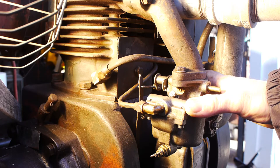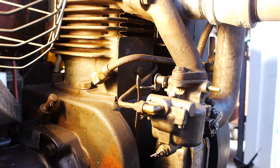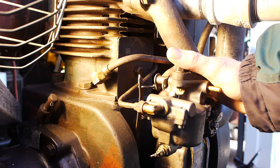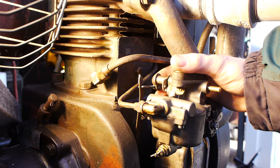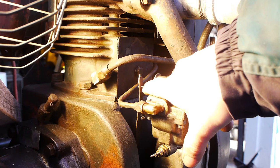I'm not going to start the engine right now since it's pretty cold outside, but that's basically the same principle of how you set the governor on these engines — it's really straightforward. You just have to make sure you do them in the correct order. First, check where the spring is on the hole. Check the chain length to see it's not slacking too much — the spring should be slack at idle, but when you put it at throttle the spring should expand; it should not always be taut. Then check the distance by threading the linkage between the throttle body and the governor arm, because that distance will change depending on where your spring is located. Once that's all set, the engine is set to run and will give you many more years of good, reliable service.